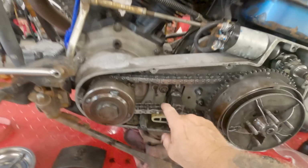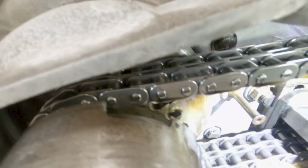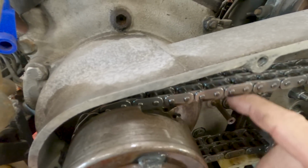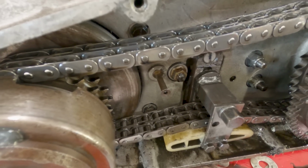Earlier I said there is a screw back here. I'm sorry, a bolt. It's got holes. Bolt. Hang on. See those holes? There's supposed to be a wire from there to there, twisted. This doesn't have it. So somebody has definitely been into this, and somebody has definitely not put it back together properly. But when you get it, it'll be done properly. It'll be done safe. It'll be working. Whoever gets this bike is going to get a fantastic bike, man.